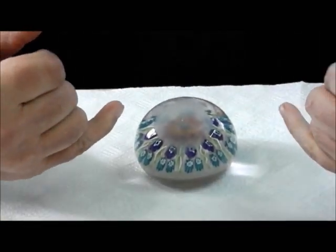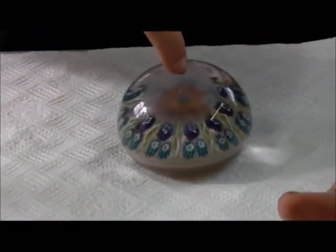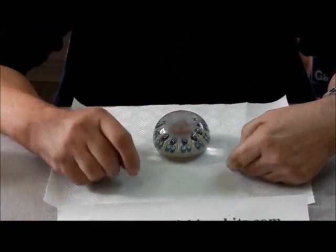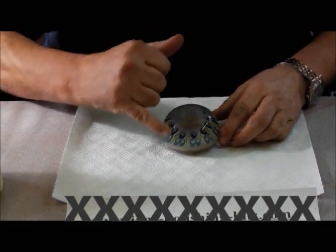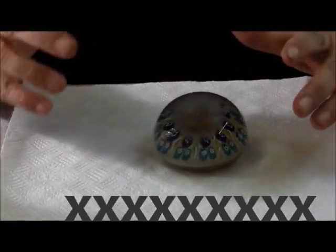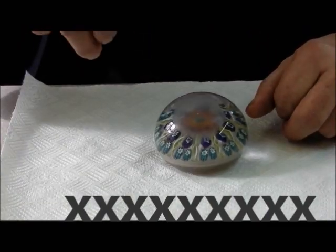What we've done is 400 grit relief — that is quite coarse scratching. We could polish down from 400 grit but we'll take it to 600 grit, as it's in the kit, and that will make the polishing easier and also take out that last piece of the chip. With the 600 grit we need to come out to an area just slightly larger than the area we've already done, just to make sure we take the feathering edge away. If you try and do the same size, you always get a bit of feathering round the edge. So we're going to start now with 600 grit.